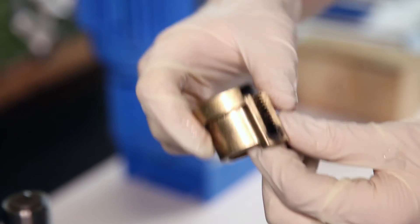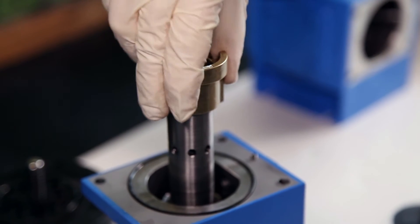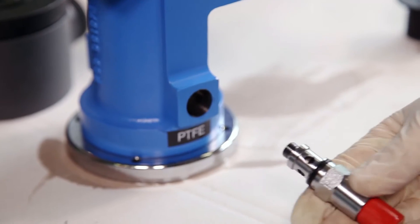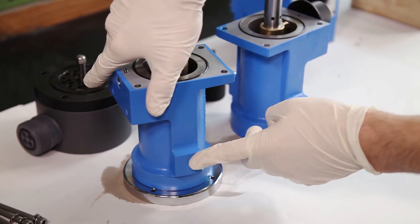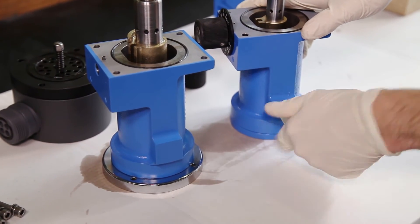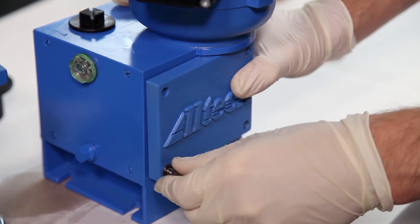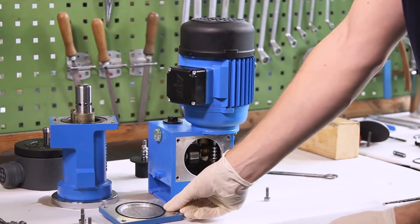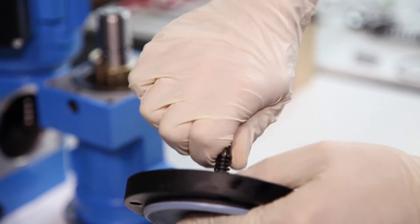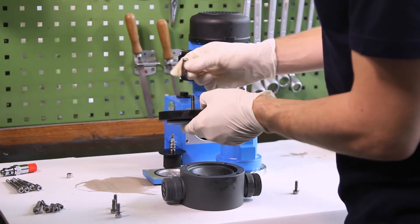The end stop of the distributing regulator has to be assembled directing towards the diaphragm. The pressure relief valve can easily be unscrewed. If there is a vent plug, its O-ring should be exchanged. But not every pump has a vent plug. The screws of the cover for the driving gear should be loosened to exchange the O-ring. After the cap nut is undone, the diaphragm as well as the diaphragm spring can be disposed of. Do not dispose of the cap nut as it is reutilized.